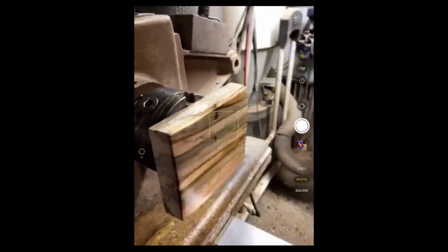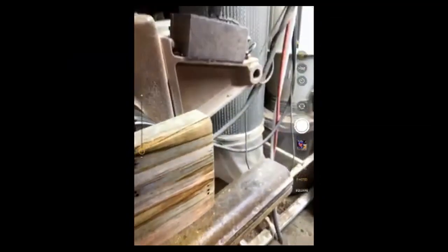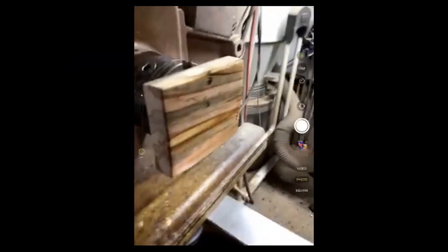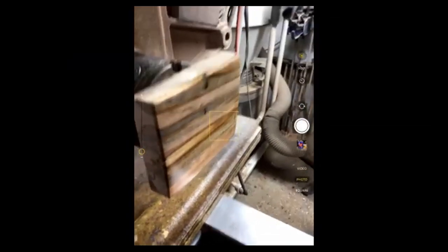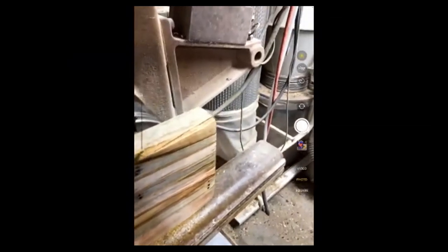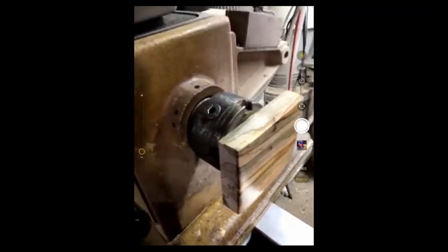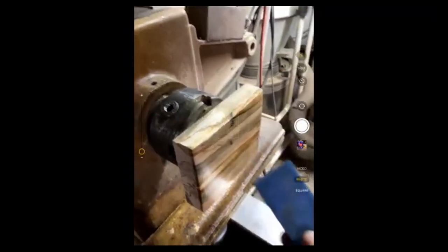See now here, you can see the sheen a little bit. Yep. And what I would do here is kind of look at this. You can already see that it's got a nice shine to it. And this is the first step. It's all nice and even all across. So this is the first step of putting this on. This is still a little wet because I just did this. But, you know, I'll get it on there and then I'll sand it in with this 800 grit foam back paper.